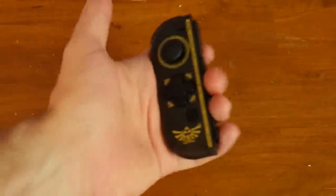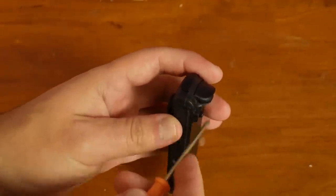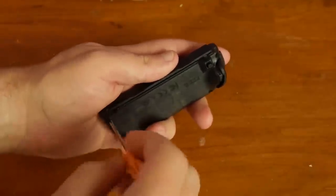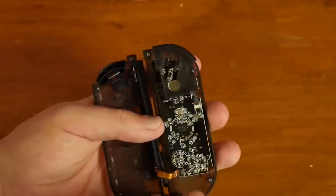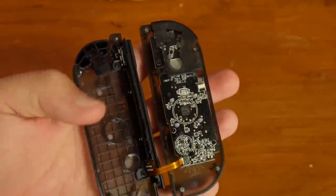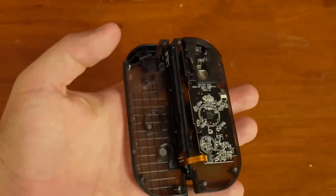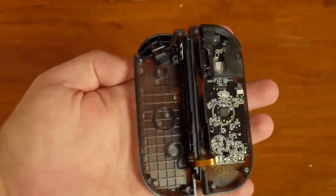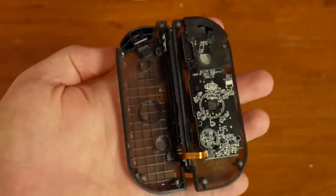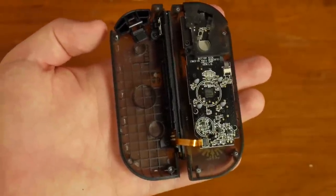Now let's go ahead and take this thing apart. It is very light and I like the design — it looks really cool. There's a couple of Phillips head screws on the back. Once open, you can see an interesting black circuit board that connects to the Joy-Con rail, which is literally there just for communication and power to make everything work. The good news is that at launch this controller would drain battery life like crazy, likely due to compatibility issues with older firmware. However, with firmware 6.0.0, they seem to have fixed the battery drain issue — leaving it plugged in now only takes off maybe a couple percent over the course of a day, totally normal.